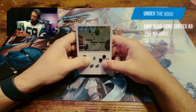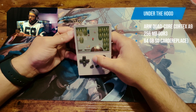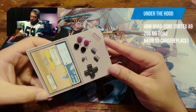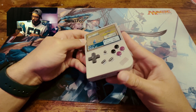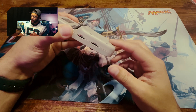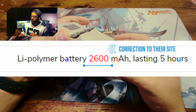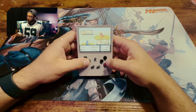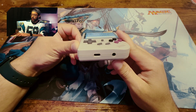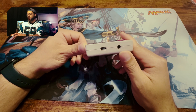Under the hood, we've got a quad-core ARM Cortex-A9 chip with 256 megabytes of DDR3. There's a 64-gig SD card that I recommend replacing with your own. It does have an internal front-facing speaker, just like the original Game Boy — audio quality is fine. The battery is a 2100 milliamp unit lasting about five hours. The charge port is 5-volt, 1.5-amp slow charger, taking about an hour to charge. At the bottom, there's a 3.5-millimeter headphone jack and a USB-C port for charging that can also be used as a controller input, with built-in controller support.